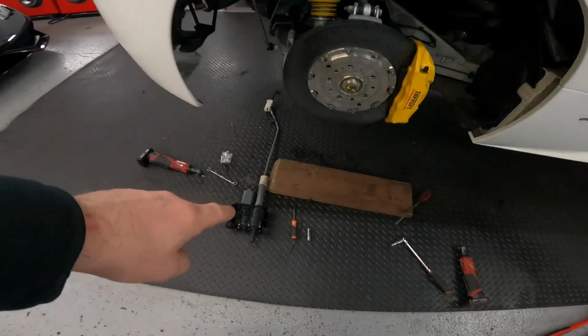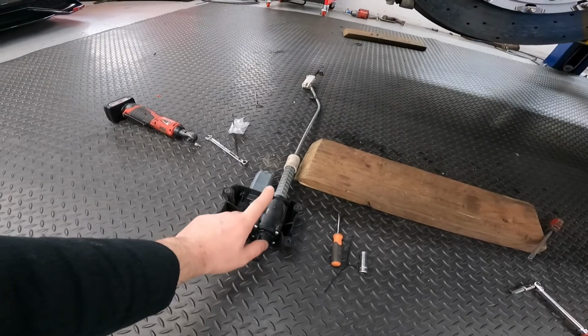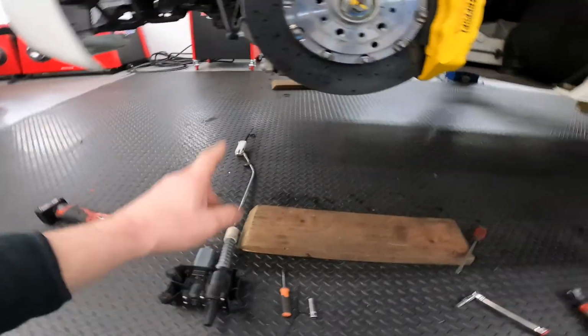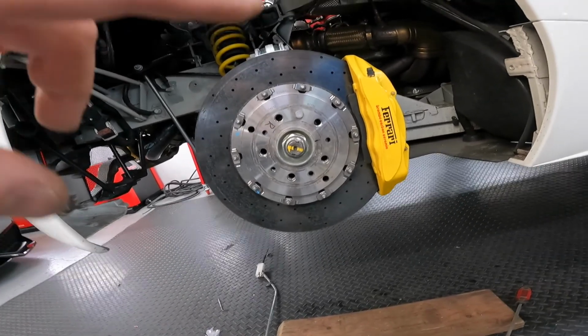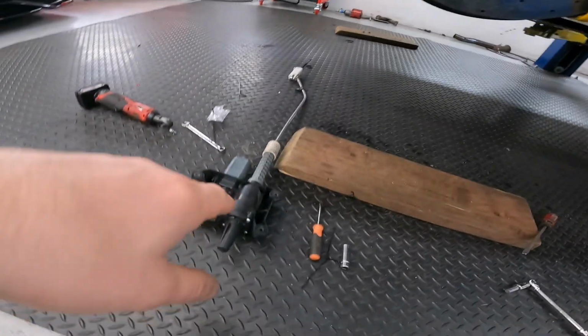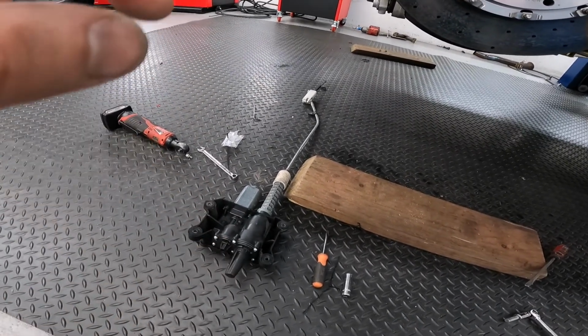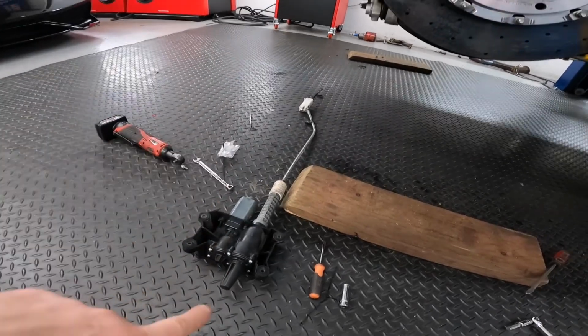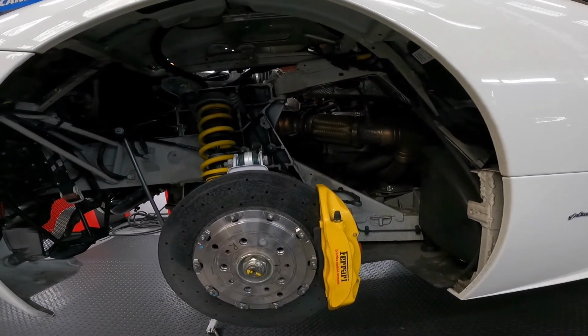We already replaced this module. This is the electronic parking brake EPB module with the cable. Then we adjust the cable from the e-brake shoes left and right side. Then we do calibration and a few more performance tests for this module, and now our system is working fine. We already installed the catalytic. We fire up. I'd like to say it's not loud. It's louder than stock, but it's not bad.